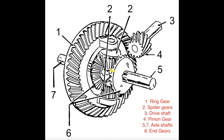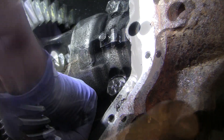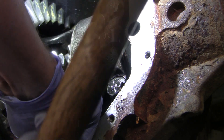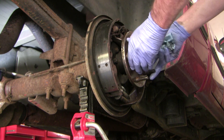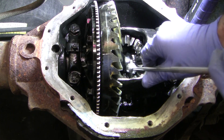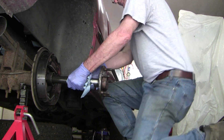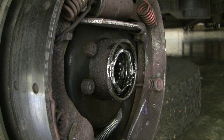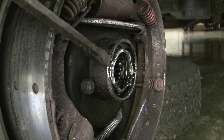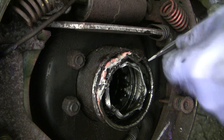Once you've got it in place, the adjusters need to be clamping the diff tightly between them to prevent the housing from shifting from side to side. Now let's get the axles out. First I remove the shaft lock screw, which requires a drop of Loctite when you reassemble. Then I'll lightly tap out the pinion mate shaft with a brass punch. Then I'll push both axles inward to expose the C-clips inside the diff, and use a magnet on a stick to remove the two C-clips. Then pull both axles out, wipe them down and clean and inspect the bearing surfaces and the bearings. Now I'm removing the axle seal — usually these just pop out with a seal puller or a screwdriver prying from the inside, but this one was surprisingly tight. Evidently the last guy to replace that seal used RTV on the outer surface. With a screwdriver and a hammer I eventually got it loose.